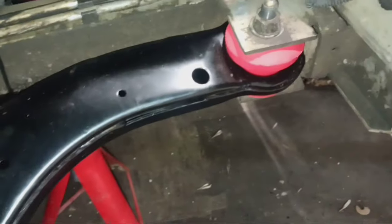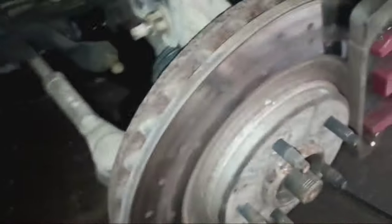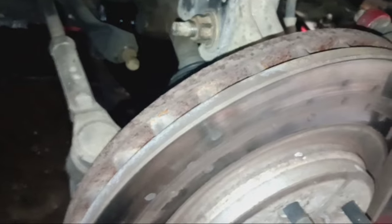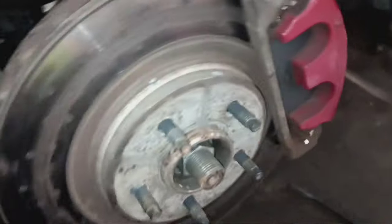Passenger side is all back together. Got all my bolts tight, got the ball joint on with the cotter pin. I can see the outer tie rod bushing is completely busted — there's a little bit of movement in it. I'm not sure if it's the wheel bearing or the outer tie rod. When I'm driving I can hear metal scraping. Looking at the rotor, it looks like it's not wearing all the way — the brake pads look pretty thin, so I probably need to get some new brake pads pretty quick.